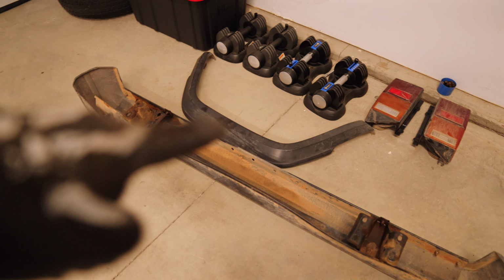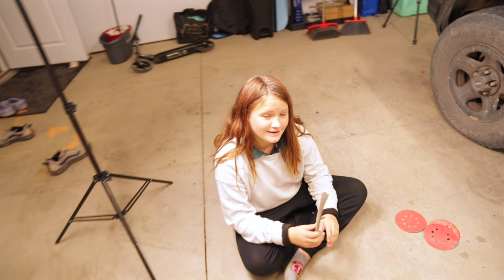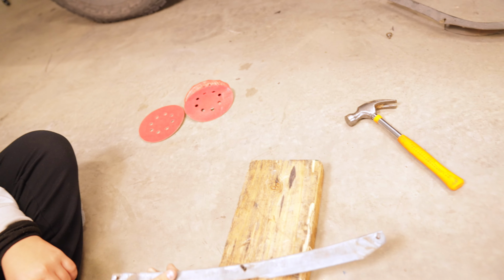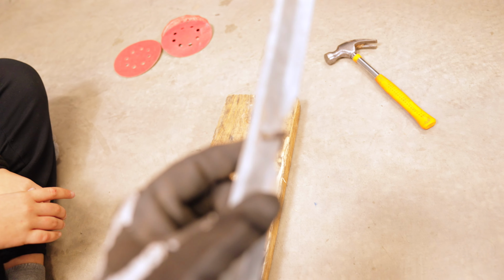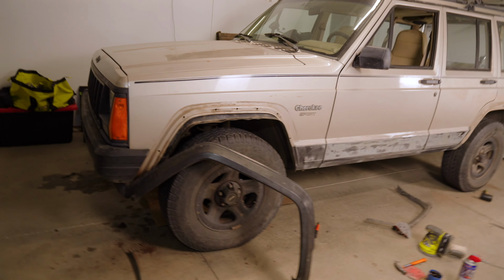That's the left rear fender flare. Like I said earlier, we have found some Bondo repairs here. It looks like the car was hit on this part. Fun stuff. All of our little bolts that hold the fender broke. But fortunately, there are brackets and we can drill them out. So we're gonna go ahead and drill them out and put new bolts in. So this one actually stayed in, but I'm afraid this one will probably snap. After a few hours of trying hard, here we go.